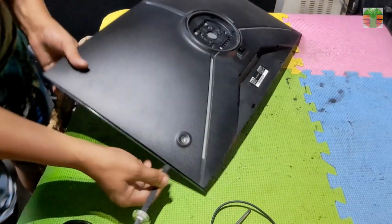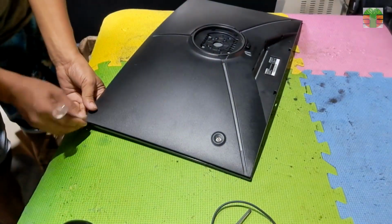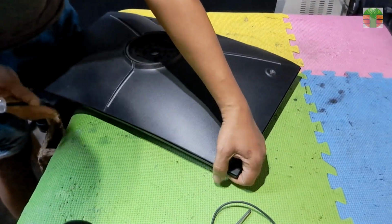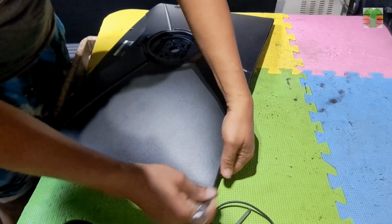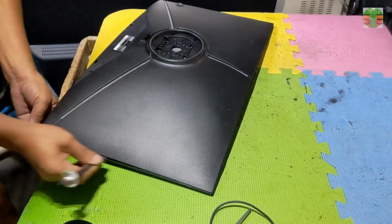I have uploaded the Envision GT27R18V3 before, but the trouble was a black stripe image. This one is a no image trouble. They have different troubles but it's the same method of fixing it. It is a cutting of the CKV lines and the LC1 and LC2 lines method.